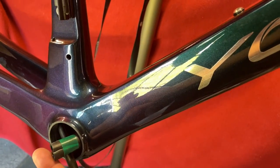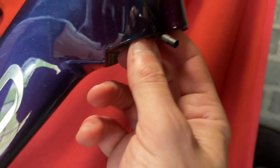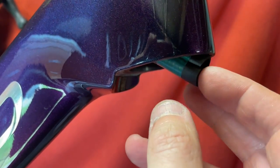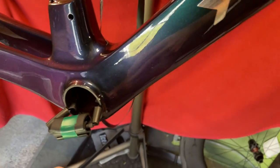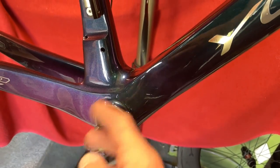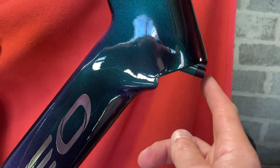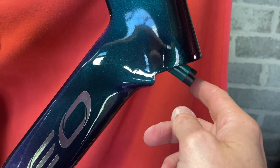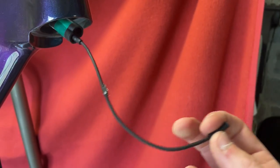So I'm going to take the wireless unit off this end and put it on this end. Here's the wireless unit on the end. I'm just going to attach something to it so we don't lose it back inside, because at the moment I've got the junction box hanging out. When I push it in that will give it more length, but for now I'm just going to attach a wire onto there so I don't lose it. Problem solved with a short 200mm Di2 wire, just so I know where it is.